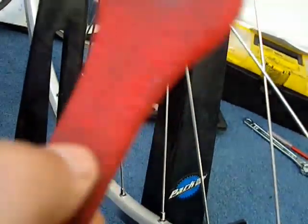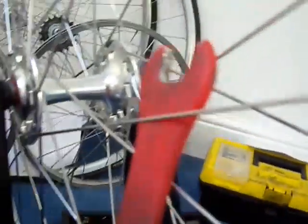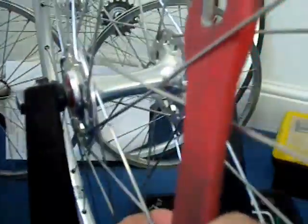So at this point, before I go any further, I'm going to do what's called stress relief. This method comes from Sheldon Brown's wheel building pages. I'm going to use a spanner because it's got this spongy bit, place it there, and then place a little bit of pressure — not a whole lot. So I press one spoke against the other and continue with that all the way around, just a slight squeeze.